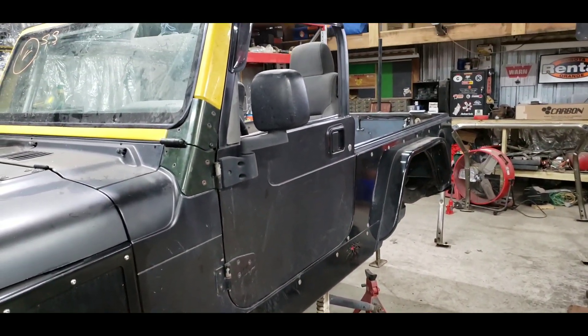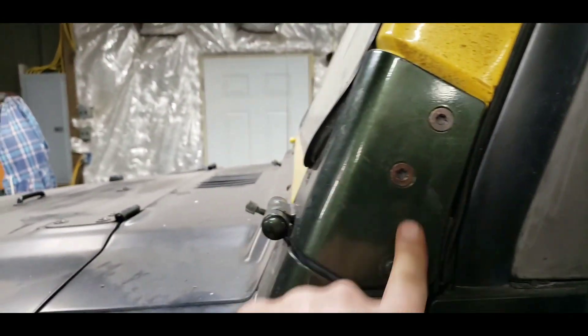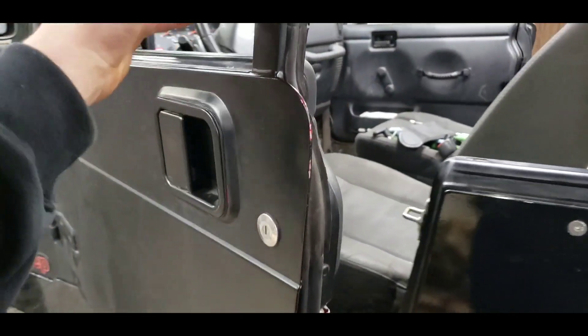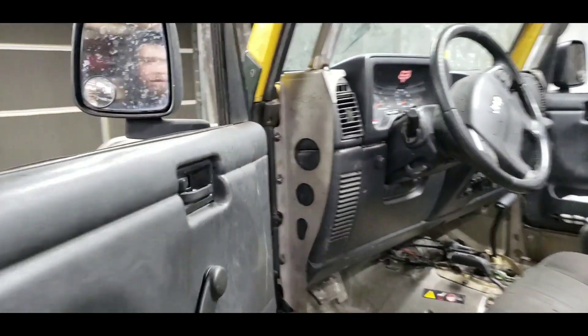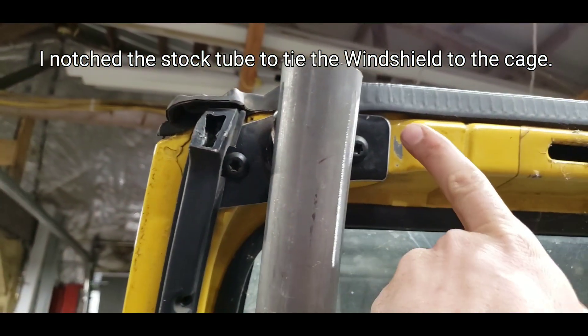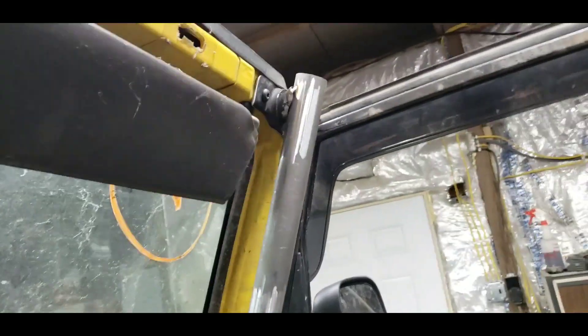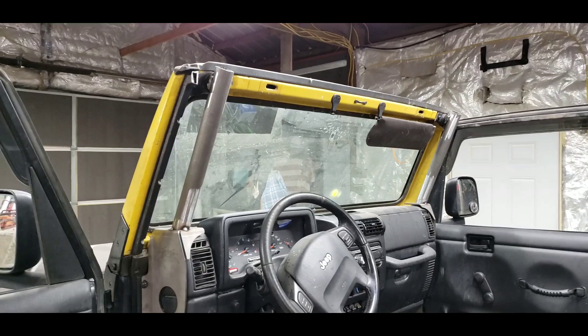Here's the driver's side — had to get a different color hinge because this windshield didn't have both hinges, just had one. All the Torx bit screws worked out well except for one that was messed up on the passenger side. Driver door works wonderfully — got the hinges dialed in a little nicer so they open and close real good. I went with Poison Spider dash mount brackets for the cage. These are my current cage tie-ins — the stock brackets, modified and notched with that Harbor Freight tube notcher on both sides — and that's how I plan to anchor the windshield at the top. Everything's just tack welded in; I'll do the final weld later.